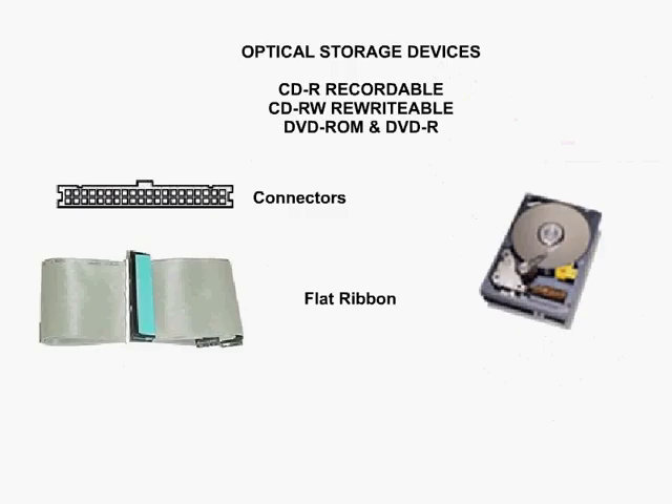Within the CD-ROM category we've got recordable CDs, also known as CD-Rs. You get these as blank CDs and place them in a CD burner which burns information onto the disk. Once that's done you can only write to it one time, but you can read that information as many times as you like. It works with a simple chemical and metal layer — when burning, the process removes part of the reflective surface to simulate the pits and lands representing ones and zeros.